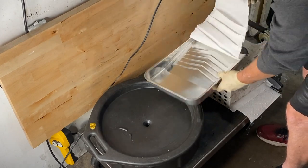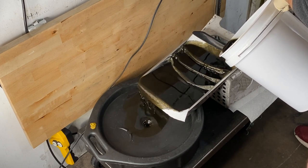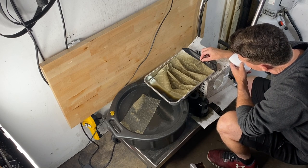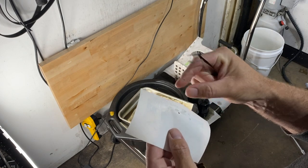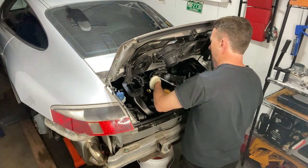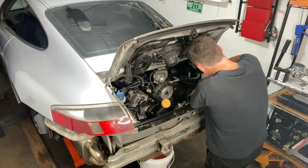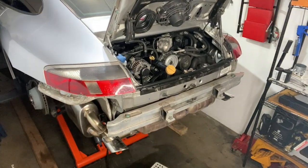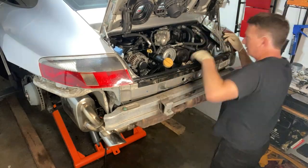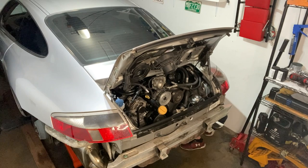This is just your regular paint roller tin — I stapled in some pleats of kitchen paper to try to catch any juicy morsels. Despite my initial fears, all the debris I found were little tiny clumps of the Graphogen itself, and then one piece of the Loctite 5900 sealant that seemed to have made its way through the oil system. Moving on now, we're draining the coolant — kind of like episode 6, déjà vu. Not taking off the AC compressor had a huge beneficial knock-on effect and saved a lot of time, because you didn't have to remove the serpentine belt, the bolt for the AC compressor in the back, or the fuel cooler from the back of the AC compressor.